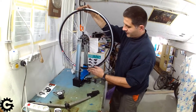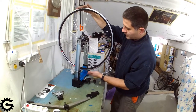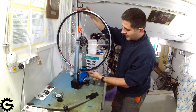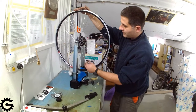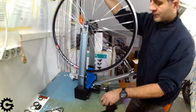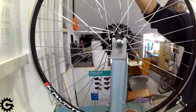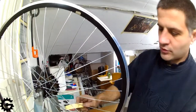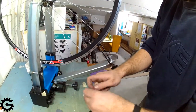So using a tension meter will give us that information, and in those terms a tension meter is a bit better tool. Using just a guitar pick, it takes some experience to know by feel, which can be tricky, and it can give us some false information. But with enough experience with one rim type and one type of spokes, one can get some memory, even muscle memory, about how tight the spokes are when pulling them, and whether it is okay. But using a tension meter is safe for now.